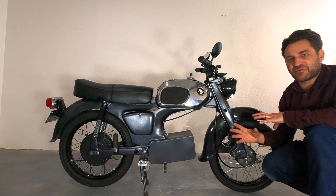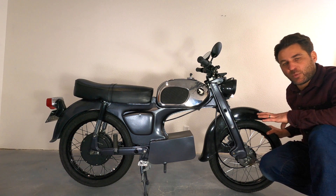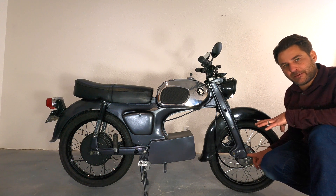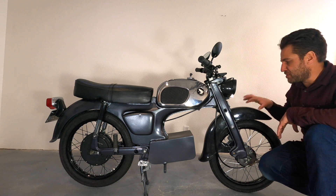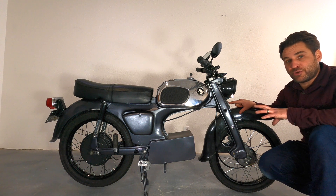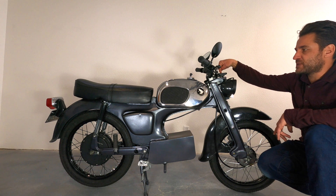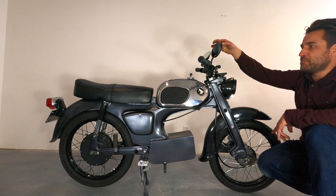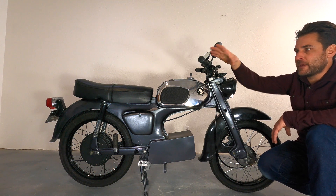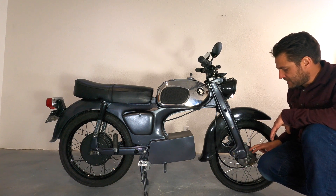Let's go over the C200 from front to back. It's got a 1.4 by 17 front wheel — this is an old-style front wheel that allows you to use all the brake parts from the donor bike. Moving up, it has a new fender, new light and horn cover, a new head badge — all new but old-style. It has an LED light, a color display, speedway bars, mirrors, the throttle that comes with the rear wheel and controller, and motorcycle-style brakes. The front brake runs through a new cable down to the old brake setup.